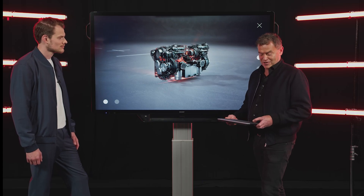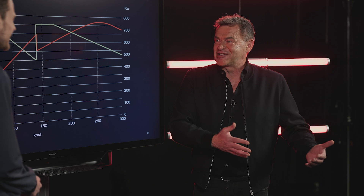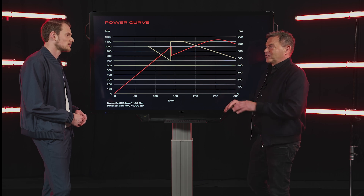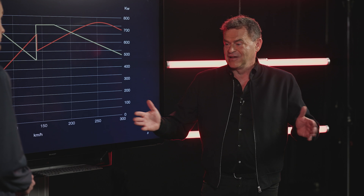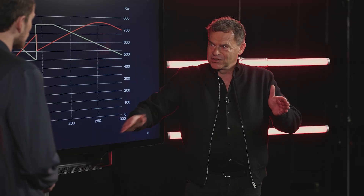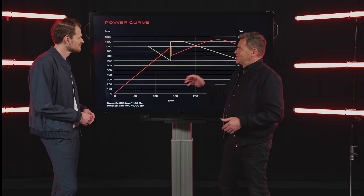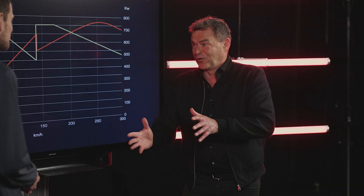I can show you on a simple graph what happens — the power curve. The greatness of an electric motor is instant torque, and this is why you always lose the acceleration on the traffic light against each and every electric vehicle. But that's also a burden, because that torque doesn't last forever. Over the rev range of an electric motor — which, as we build it, may be 16,000 to 20,000 RPM — that torque lasts maybe to 40% of the whole rev range, and then it drops. That gives you a power curve where the relationship between RPM and torque drops as well.